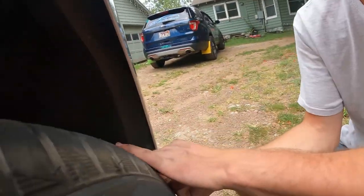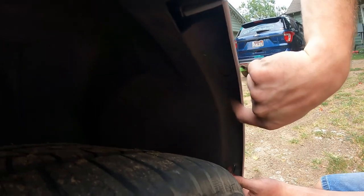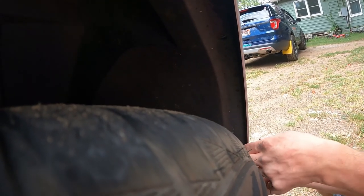Here's what we're working with. We've got two screws — one here, one about right there — and then a bolt up here that is a 9/32nds, so we have to get all of these off. If you're just changing the bulb itself, you can go this route. But if you've got to take the headlight assembly out entirely, go ahead and follow the next steps.